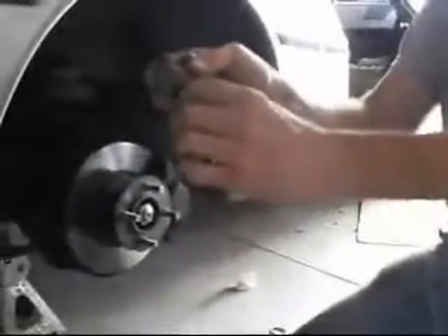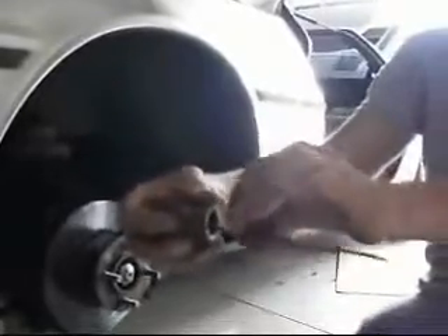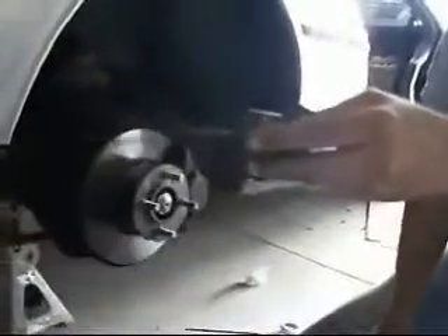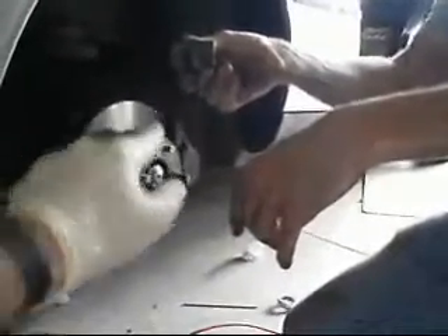The Houston ones don't look like that. See the lubrication screw? You can buy it from your vendor of choice with the nut already on it. Notice that the lubrication screw is upside down. I'm convinced that this thing was designed to go on that side of the vehicle because of the direction of the winding. When it's oriented like this, primary wheel rotation is unwinding this. You know how it turns into spaghetti inside of the spindle sometimes? Look at the way it's wound.